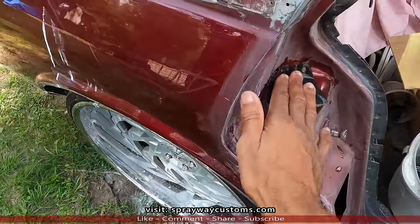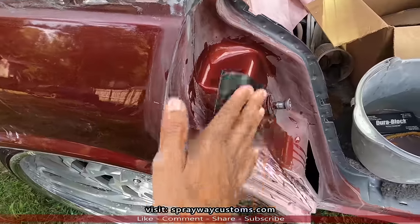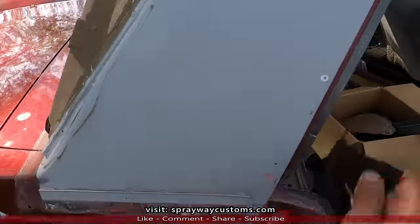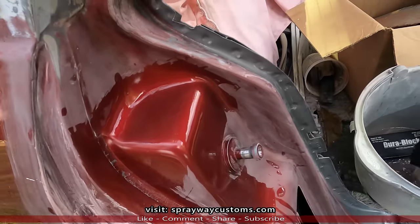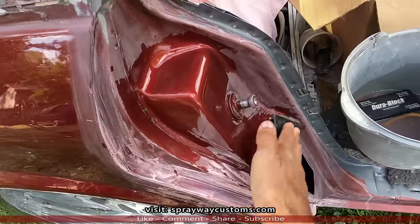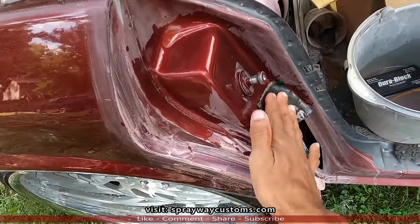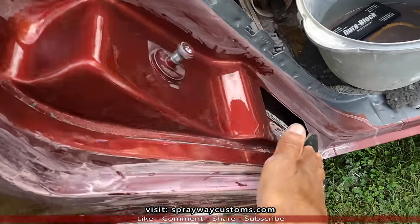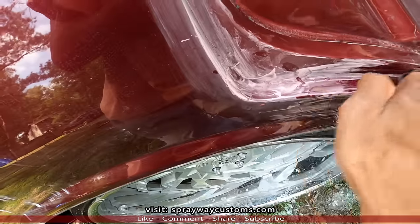I'm finished up sanding the jams now, by hand. I used the block up here on the flat area. I could use a maroon Scotch-Brite on these jams, but I just continue using this 400 grit wet sand. I'm just going back over, touching up spots that I seen that was still shining.